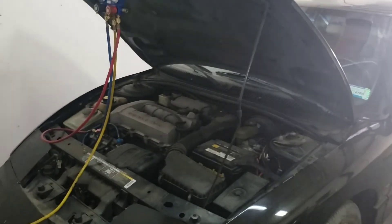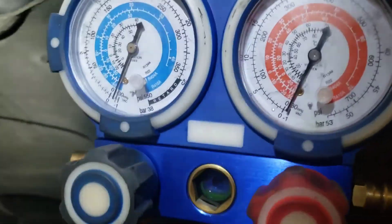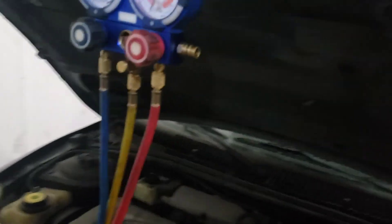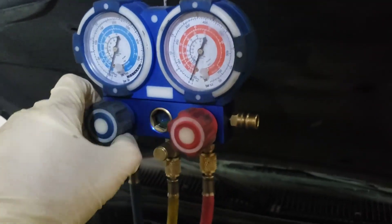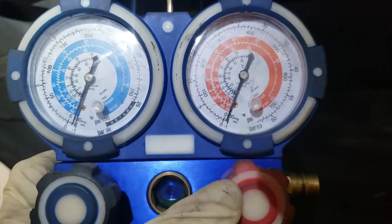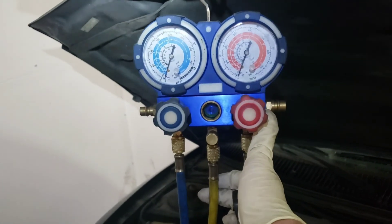The customer just came and picked up her Altima. Now I'm working on the Saturn and it looks like it's maybe got a small leak because I had vacuumed it down about an hour ago and the pressure dropped a little bit, but it's hard to tell. So I'm going to start up the vacuum pump and open the low pressure side, let that run for about five minutes, and then come back and check the pressure again.